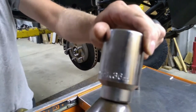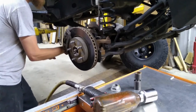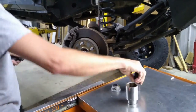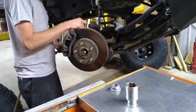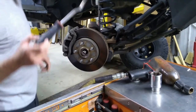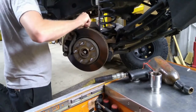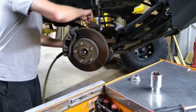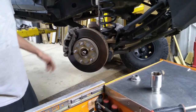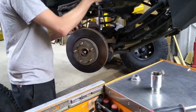I muted the audio so I didn't kill your ears as we go through here. I took the axle nut off. Now I'm going to turn the spindle by putting my pry bar back behind the ball joints and on the caliper — that gives me access to these caliper bolts and will also slightly compress the brake caliper, making it easier to remove. Once all the bolts are out, I want to pop a couple of these clips on the back side for the ABS sensor, so it's no longer connected to my caliper hose. Once that caliper is off, I'm going to hang it off an S-hook I made out of some brake tubing so I'm not straining the hose.